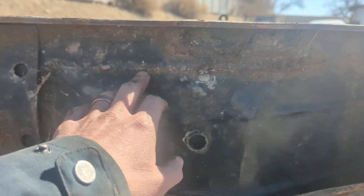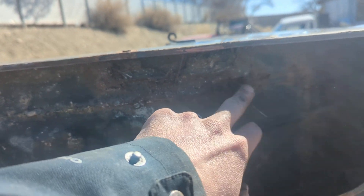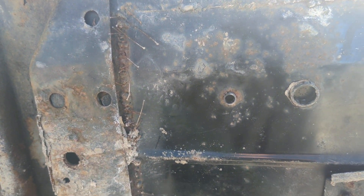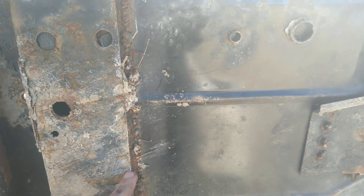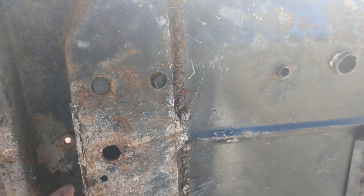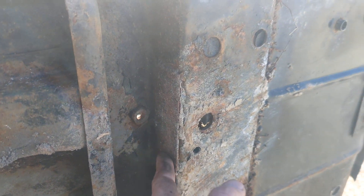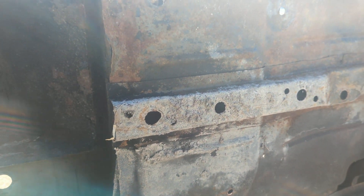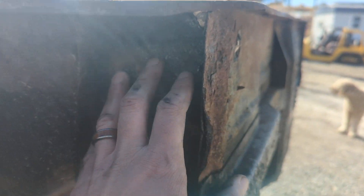Here's the side that was replaced, and they did a terrible job. It's got stick weld. Somebody clearly didn't know exactly what they were doing. The panel looks okay — it actually probably can just be cleaned up. I don't know if it needs to be re-welded; it's pretty strong. Looks like there's a plate here possibly that reinforced it.